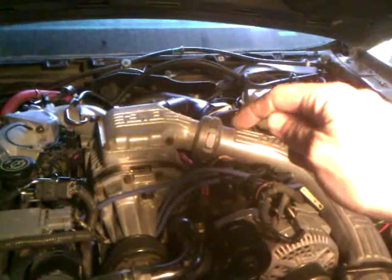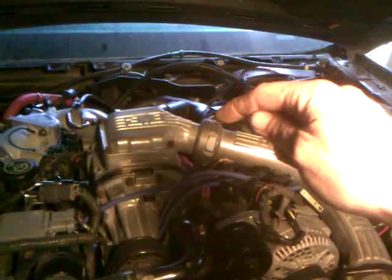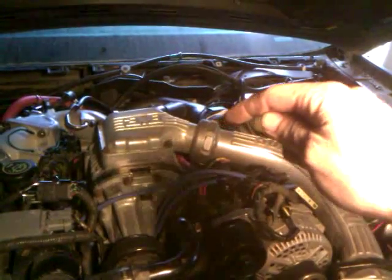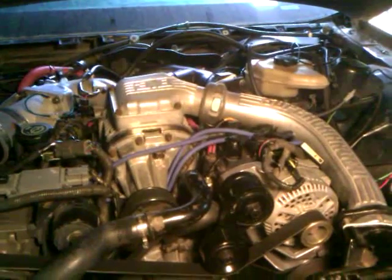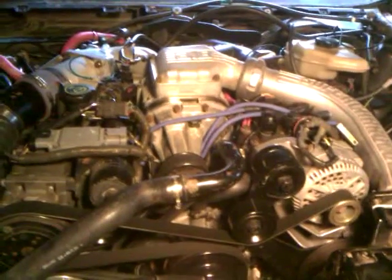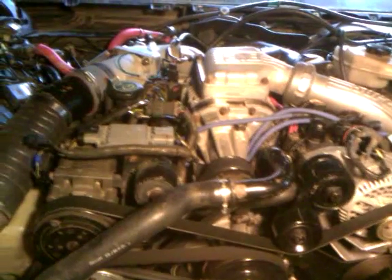And right there, the return elbow into the intake manifold was not a perfect seal. I hit it with some carb spray, and sure enough, it found a vacuum leak right there. So that's causing a lot of issues. But now I got all the vacuum leaks hopefully knocked out. I'm going to go through with this can of spray as it warms up and try finding some more.